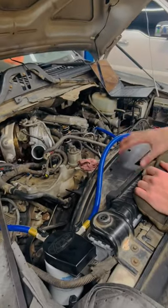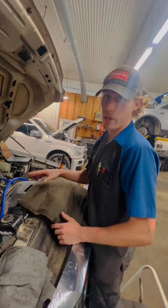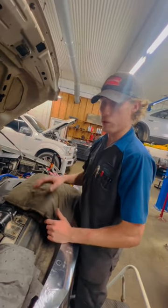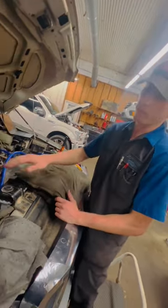The number one weakest point about six-liter Power Strokes is when the cooling system gets dirty, so this is a huge, huge help to making that coolant last. If you don't have one of these, you probably need to be changing your coolant every 30 to 50,000 miles. With one of these, you can probably go 80 to 100,000 miles without worrying about that coolant — so get you a coolant filter.